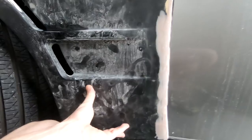Just going to fill you in on what's going on right now. We put the fender back on to test fit it after a bunch of filling and sanding. We're really close with the body line now — it's starting to get even, just very rough and not completely flush to the surface, so I'm going to have to fill and sand more. Down here we've got Bondo tabs — one right there, one right there — that I need to drill through so the fender can be held to the car. Then I'll start making my markings and measurements to see where I need to shave and continue filling, including up here as well.